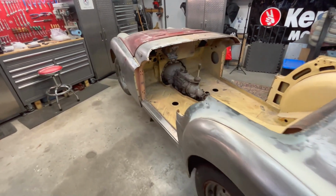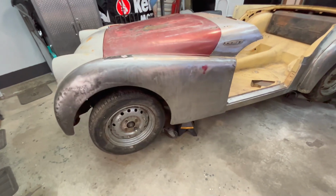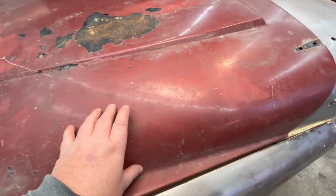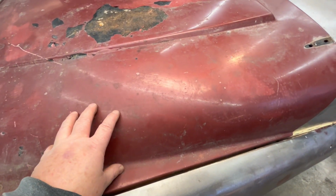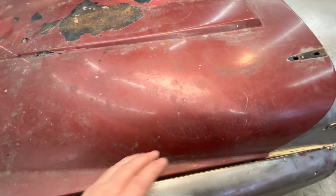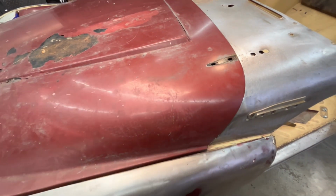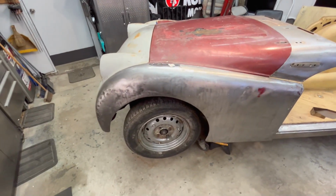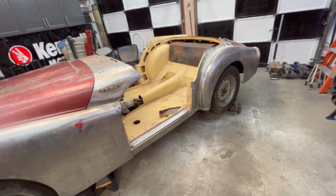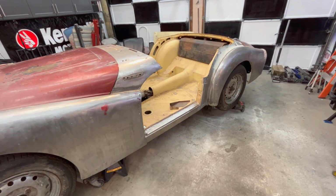I think the next step for me now is to go back and put in the shims in all the bolt-up locations where I've got everything bolted loosely at the moment, with the exception of those two fasteners in the engine bay, which do not align. That could have something to do with this bonnet fitment up here. I'm going to do a little bit of calculations and see, maybe this inner fender here got put in the wrong location and moved further towards the rear of the car, which is preventing the hood from moving forward on that tie bar. So that could be possible. Anyway, I'm kind of rambling at the moment, but we'll figure it out eventually. I think the first thing to do right now is to put the shims back in, get everything bolted down, and see where we're at after that is done.